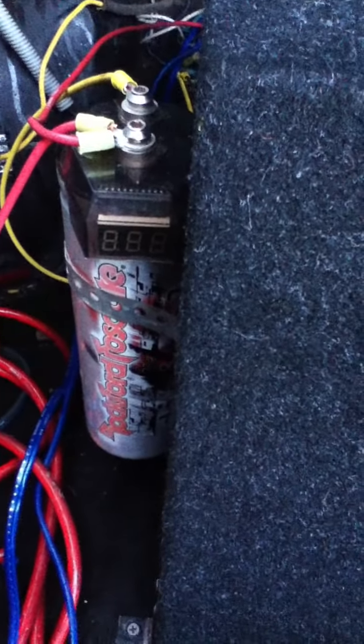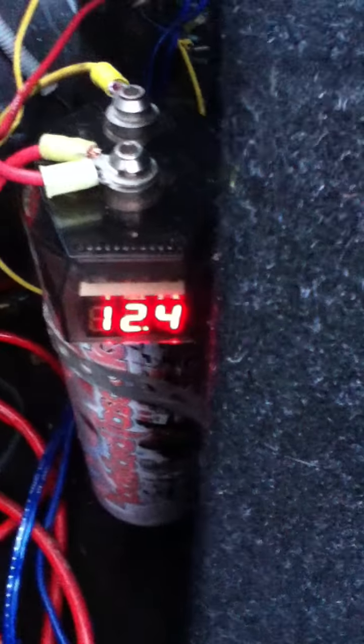Here's my capacitor on the sub box. It's not lit up right now — it's usually lit up. I hope it didn't break because I'd look like a dumbass making a video with my own capacitor broken. It might just not be charged enough from running the car today. We'll turn the power on and see — okay, we're good. It's holding 12.4 volts.